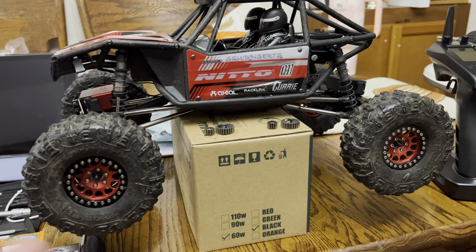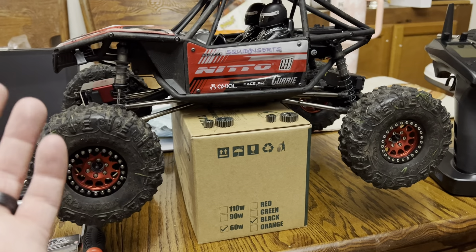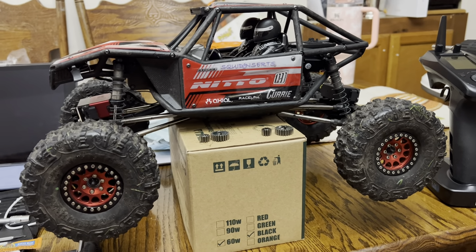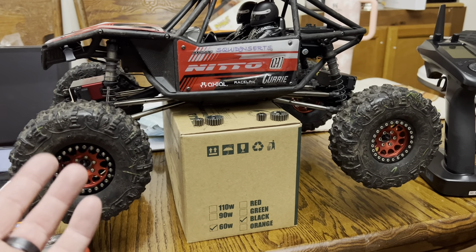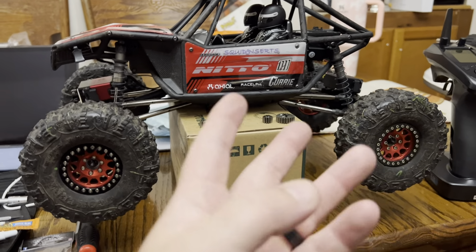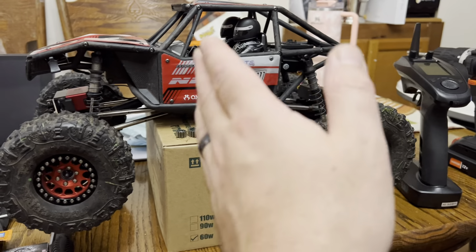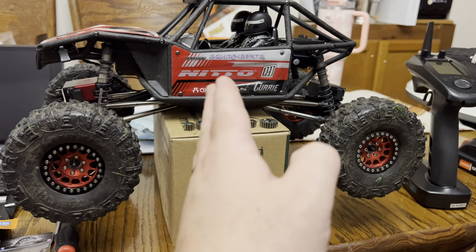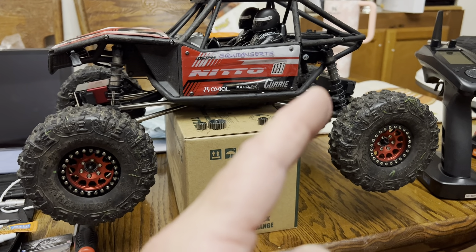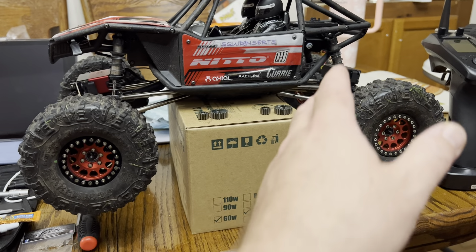Some theories say if you don't have enough front traction, your fronts just spin and your rears will still kick you over backwards. One thing I think is really cool about overdrive: your front steers tighter, because the front tires are spinning quicker than the rear. When you turn, they're pulling you that direction 30% faster. Instead of the truck wandering because the rears are shoving it, with overdrive the truck just pulls and turns — a much tighter turning radius.